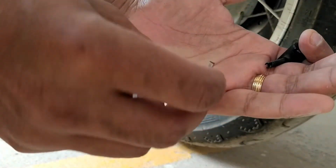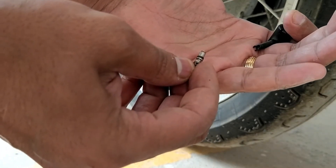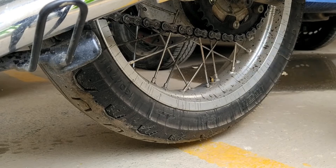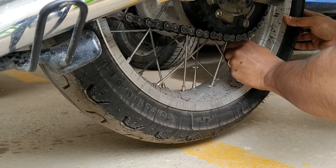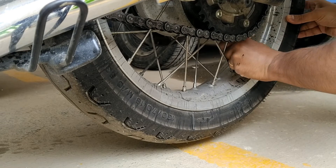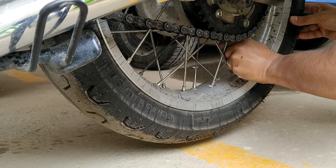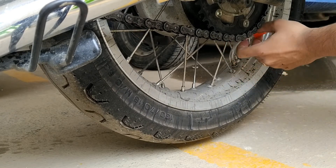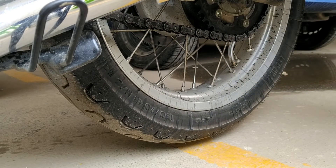To put the liquid in, you need the valve at the six o'clock position — at the bottommost point. Then put this clear pipe onto the valve; it will fit very snugly and could be a little tight, so do this patiently and don't damage the valve or the rubber inside the tire.